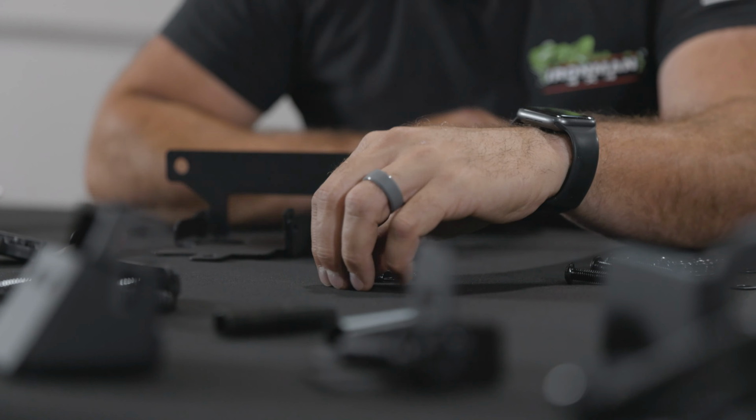We've got our parking sensor wire harness all zipped in. Now is a good time to get your pod lights installed because it's a lot easier doing it on the bench than trying to put them on in the truck. So if you've got your lights, get them installed now. Now that your lights are in, don't forget to put this gravel guard on. You can run your pigtail through the center hole there. This will keep gravel and stuff that kicks up, keep that stuff protected. The size of these Allens is a 4.